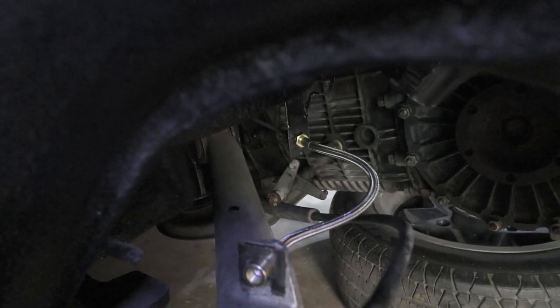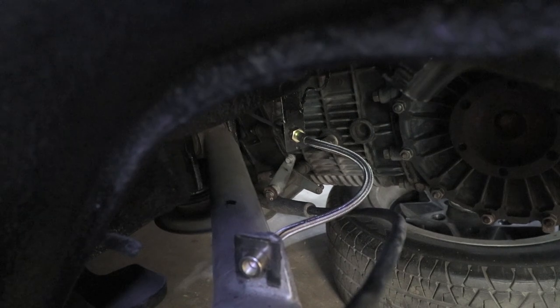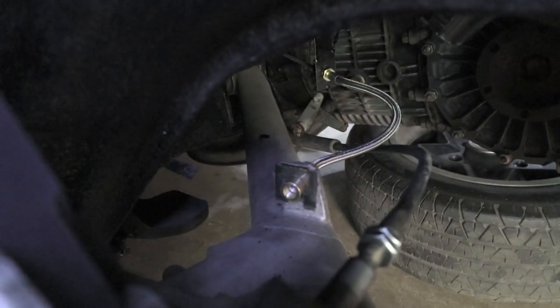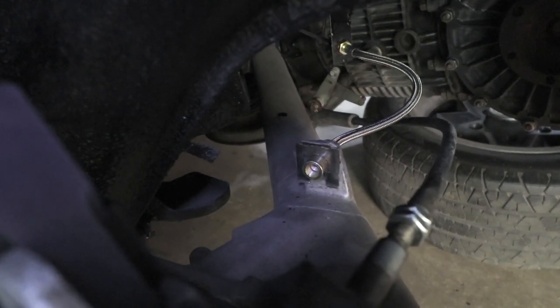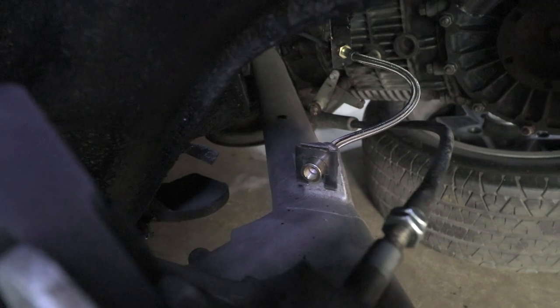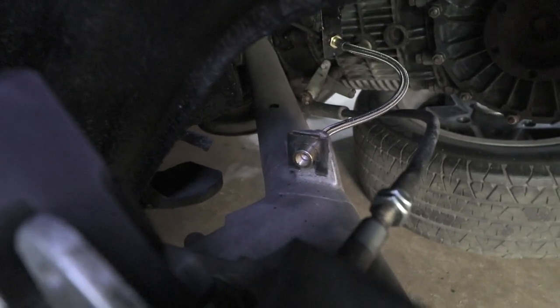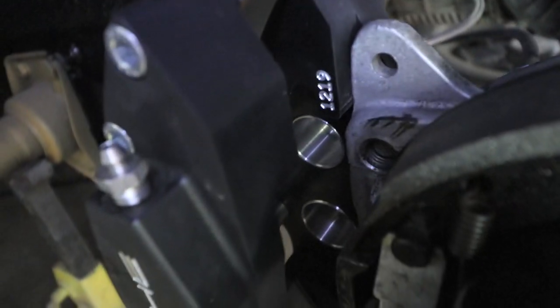That's the brake line from the little tab that hangs down from the seat pans, which I had to make myself. The brake line runs through to the trailing arm and gets that clip I just hammered in — that's the part that flexes when the trailing arm flexes. Then the other part that goes from that terminal to the one on the back of the caliper is a hard line.